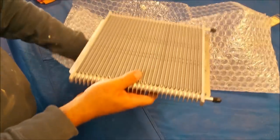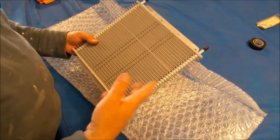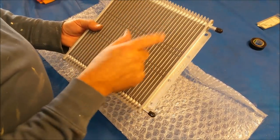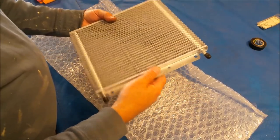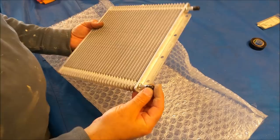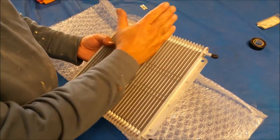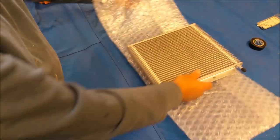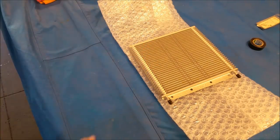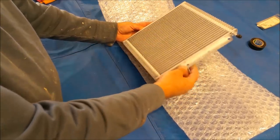Here it is - that is a great bit of kit. I use these to bypass the cooler in the radiator - I don't like the idea that they can rupture and send coolant through your transmission. You can get little ones of these and it might even be better just using one of those low down on the Sigma's radiator for the power steering. This one took a while to get because it's got 5/16th barbs, normally the big ones have 3/8th barbs. The Sigma would use something around 3/8th or 10mm hose. I'll see if I can find a good way of mounting the cooler that comes with it.